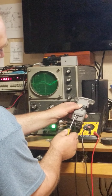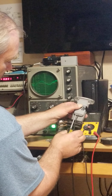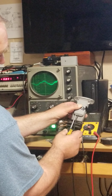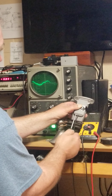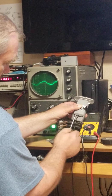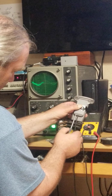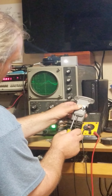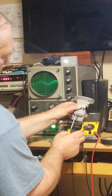Now we're going to start turning this screw counterclockwise. Make sure to pull your screwdriver away occasionally in case you've got some magnetism to your screwdriver. We're going to keep upping the sensitivity, turning counterclockwise, rotating the screw outward as if you were trying to unscrew it. Okay, there we go. Our light just came on. We're going to want to take at least a couple of good turns.